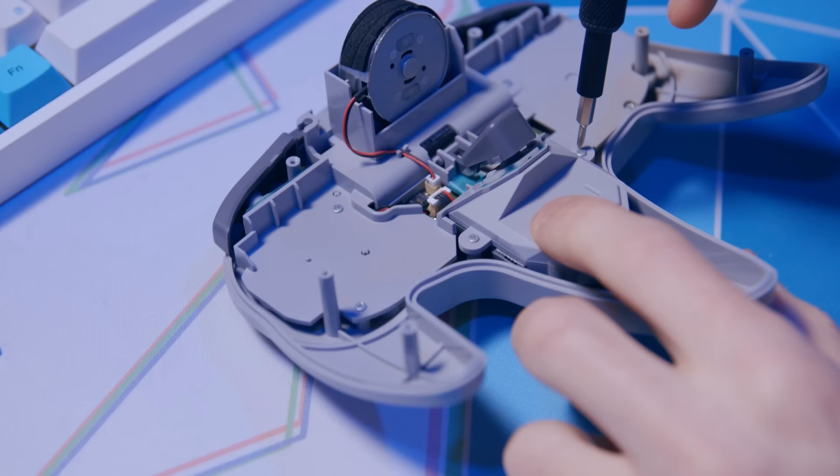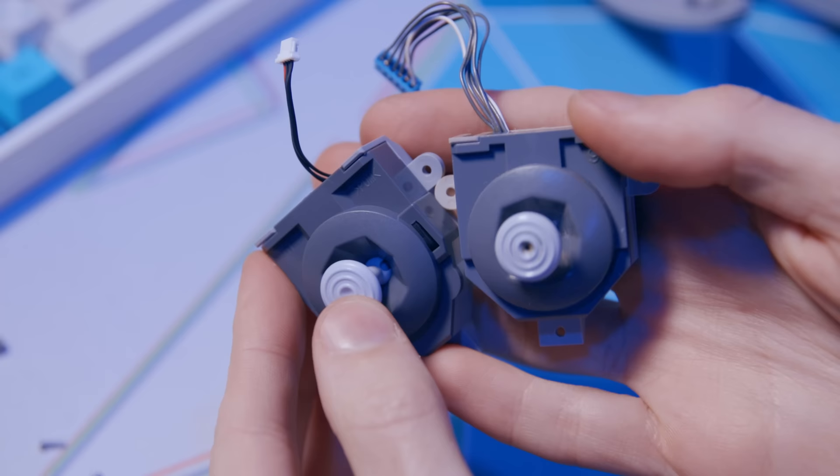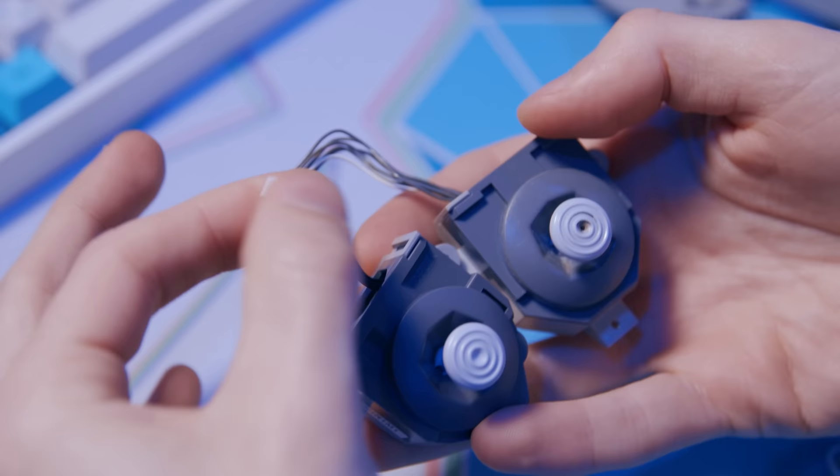But that's on the original N64 controller. If you open up the new N64 controller, you'll see it looks a little different inside — a lot cleaner, with more plastic and a new board. There's rumble built in, it's wireless, and it has extra buttons the old one didn't have. But the thumbstick is basically identical except for the connection — there's a six-pin connector on the original and only a four-pin connector on this new one, and that's where this thought should have ended, but it did not. It's been three days since my new N64 controller has been in pieces on my desk.